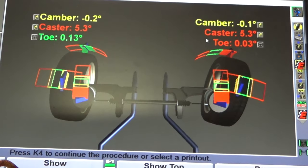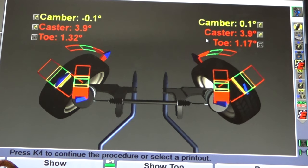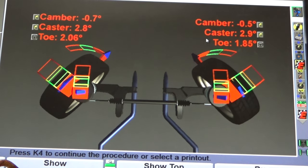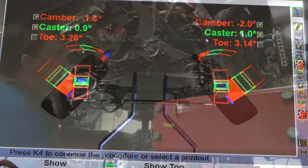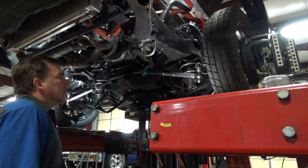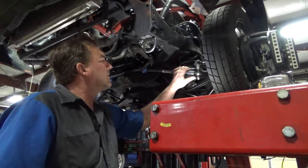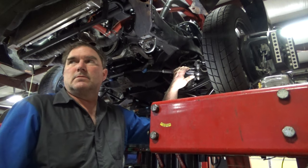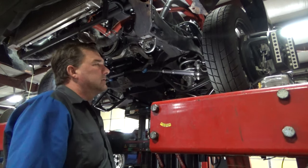When I lift this car, we're at six and a half degrees toe-in on lift — that's excessive. It's peeling tires and causing drag. That's almost six inches of lift, which is pretty significant. With the weight off the tires, I'm going to move my shims. The question is: do I need to go up or down? Let's go longer and see if it gets worse, because that's pretty quick and easy.